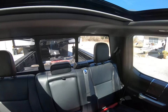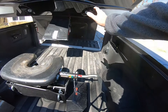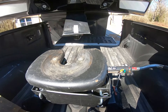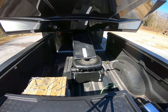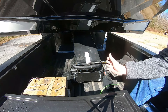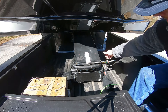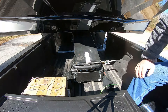From this point on, I'll go ahead, look over my shoulder, and as you can see back there, it's pretty lined up. As we back up here, I'm going to unlock the hitch so when the fifth wheel pin slams into the hitch, it'll automatically lock in place. That was pretty darn close — we didn't have to maneuver up or down at all. It locked right into place. We've got a green light on our coupler indicating we're good to go and locked in. I'm going to flip this locking lever over, put my safety pin in, and we're all hitched up.